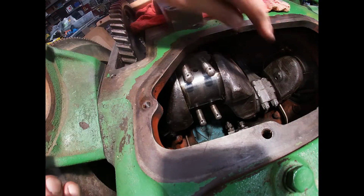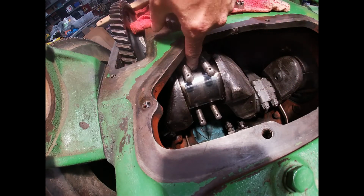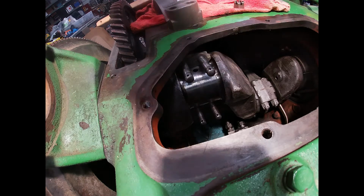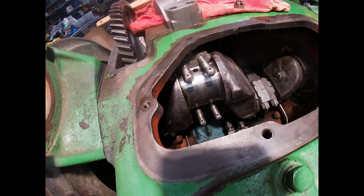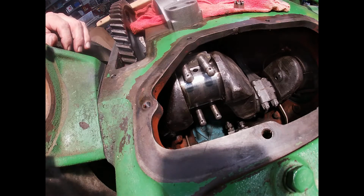oil up through there. And one of the things, the oil pump pumps oil through this crankshaft, through what's called the journal, and there's another hole that goes through the rod all the way up to the forward end of the piston. So once you get everything going, the oil pump's pumping oil through all those surfaces.